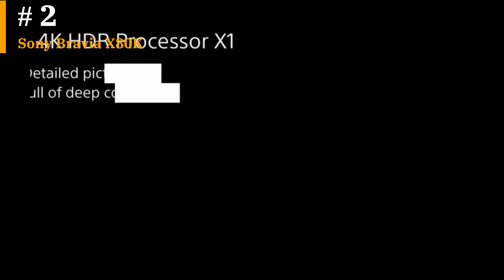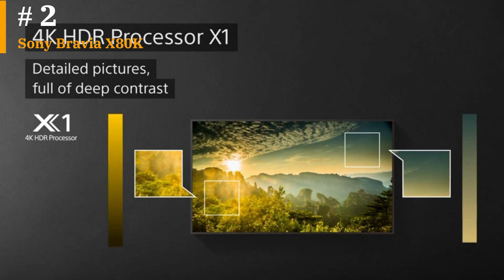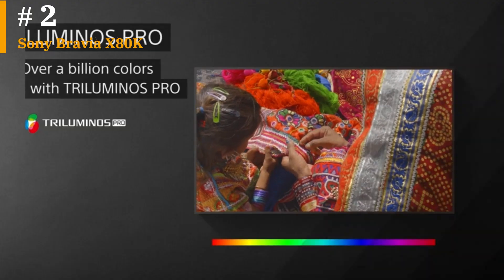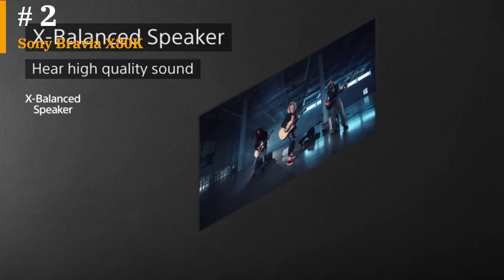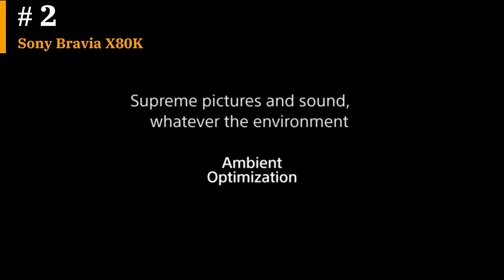It doesn't, however, quite compare with what you'll see on more advanced, and thus more expensive, sets from Sony and other manufacturers. This was borne out by our lab testing with an X-Rite i1 Pro Spectrophotometer, a SpectraCal Video Forge Pro Pattern Generator, and Portrait Display's Calman calibration software. The TV's maximum SDR brightness was on the lower end of the spectrum of TVs we've tested — 272 nits in standard mode and 248 nits in custom mode, the closest to an out-of-the-box calibrated picture — whereas the 43-inch Samsung Q60B QLED TV managed 378 and 313 nits in its comparable modes respectively, and the 50-inch Vizio M-Series Quantum smoked both in standard with 499 nits, but came in third in its best mode with 121 nits.